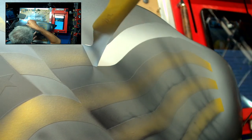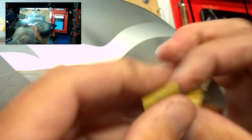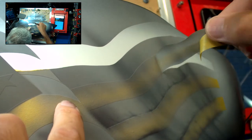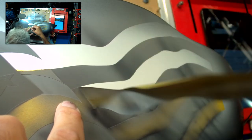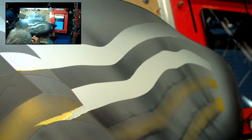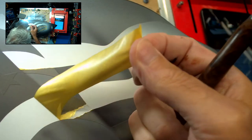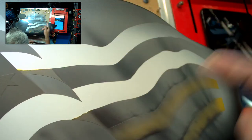Once I pull this off they're off, because this mask is really thin — once you pull it off it curls up and gets all weird. I suppose if you're really talented you could save it, but I don't bother; it has done its job. What you're seeing — the white — is Auto Borne Sealer. That's not opaque white, that's the Auto Borne Sealer. I chose that because of its strength and the way it adheres — I knew I could mask on it and not worry about any of it coming off.